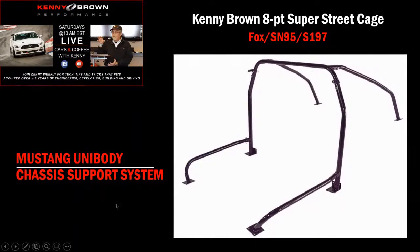And we used to build these. We'll probably get them back in production someday, but this was our inner skeleton, as we called it, the super street cage. And this really has a huge amount of internal structure. Even though it looks like it might be a 6-point, in actuality it was an 8-point. We've got the main hoop, so there's 2 points there. We've got the rear bars, 2 points there. We've got the front bars, 2 points there. But also, these little tabs up here, we actually bolt to the seat belt bolt in the B pillar, which actually makes it more rigid.